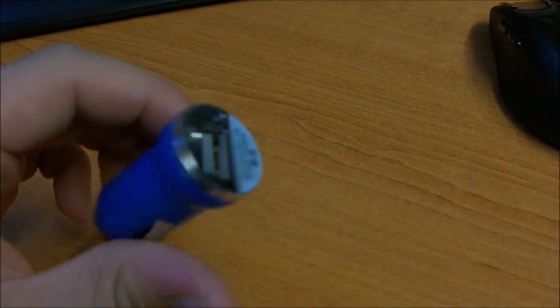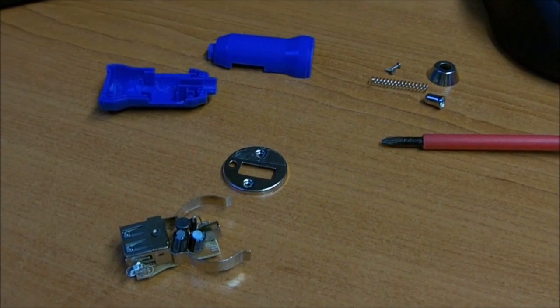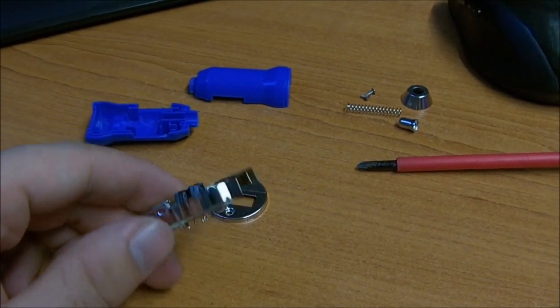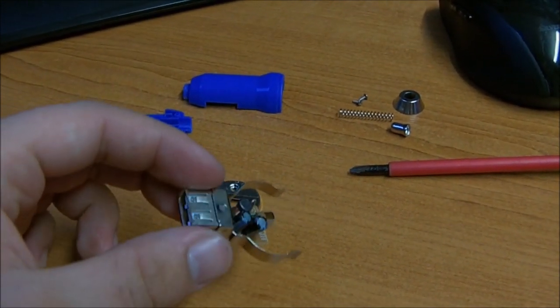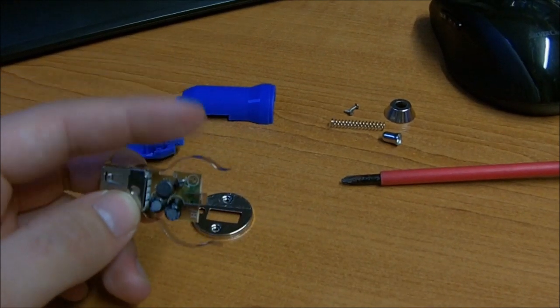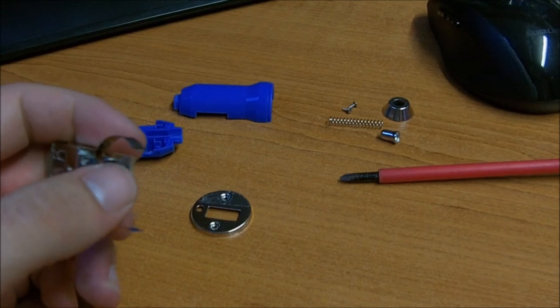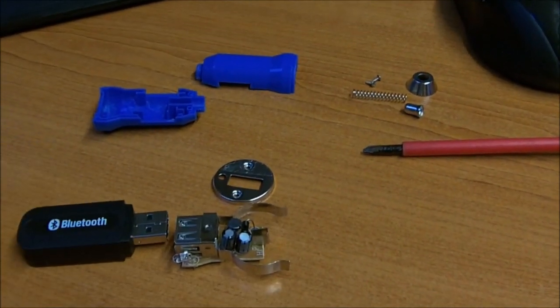So let's take it apart. Once you've got the casing off, you'll realise there's actually next to nothing to it — there's a little smoothing circuit on that side and that is the voltage regulator. I'm going to cut these big negative terminals off and put a wire on that, then put a wire onto the positive, and then my Bluetooth module will just slot straight into that.